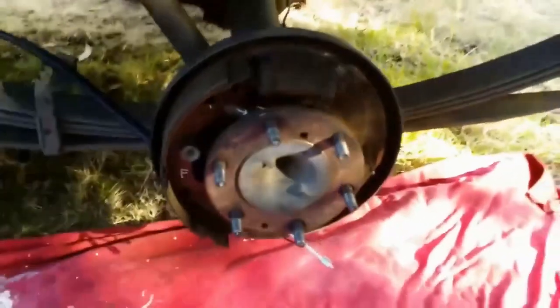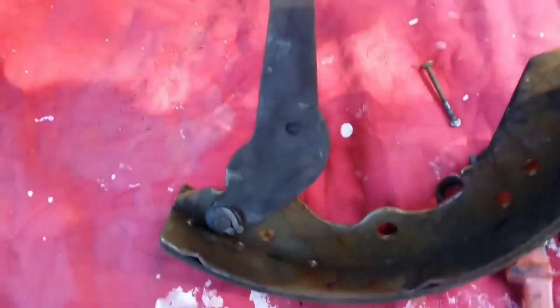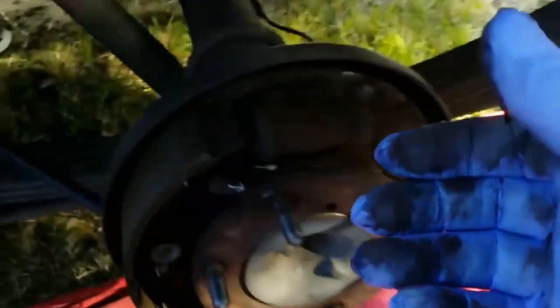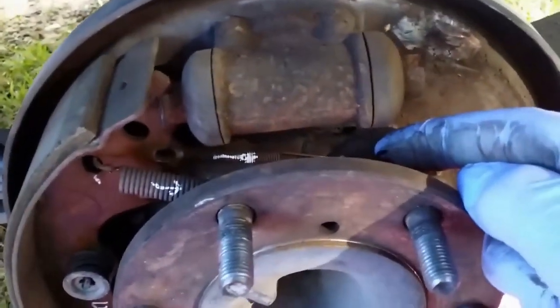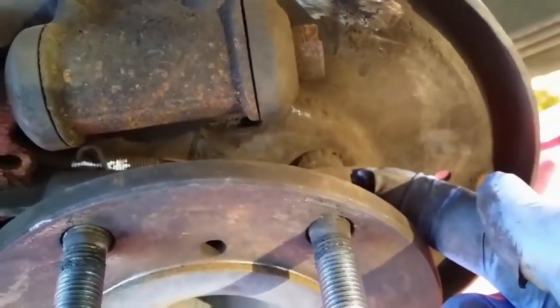The hardest part as you put the shoe back on is this spacer and the spring behind - you've got to line it all up and get it back on. So there's a cable through the arm of the shoe now - we'll just get it and flip it around, put it on the drum frame. What I did last time was get this small spring, put that on first, and then use this to lock the rest in.